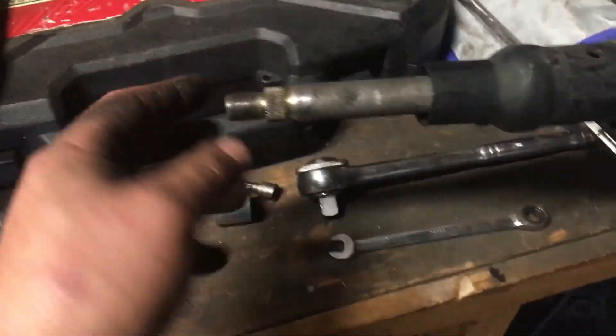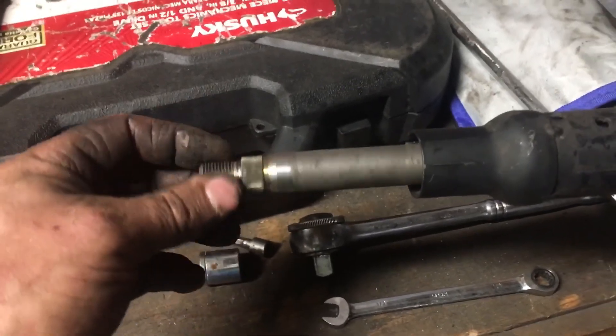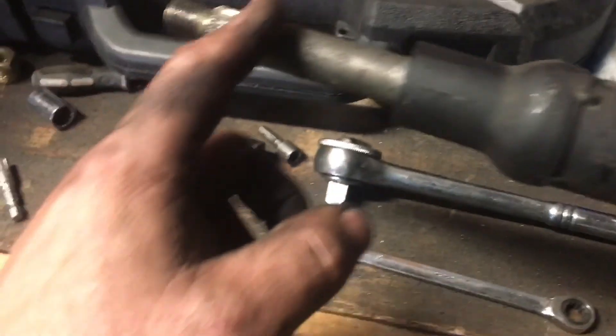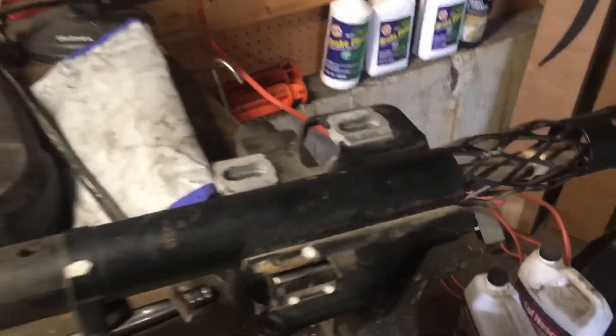The splines are slightly smaller on the Range Rover shaft compared to what's needed for the Series 3, so I'll temporarily put the Range Rover steering wheel back on. This shaft is now separated from the lower section. I could take the shaft out and modify the splines on top, which could be great, but I have no need for these ears. I'm going to go ahead with the grinder and take off those ears since they serve no purpose using this column from the donor Range Rover.